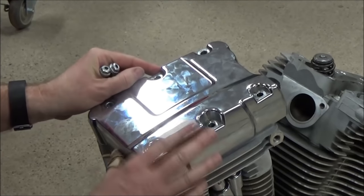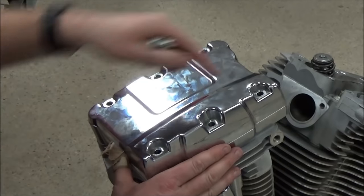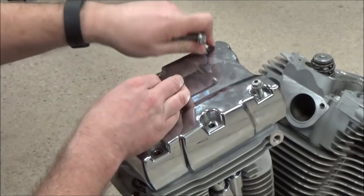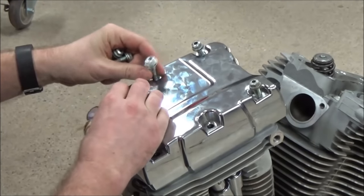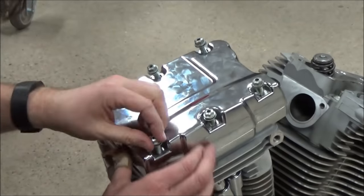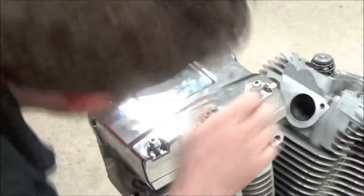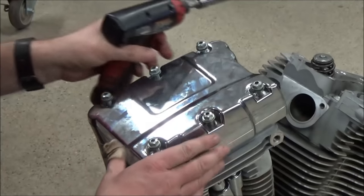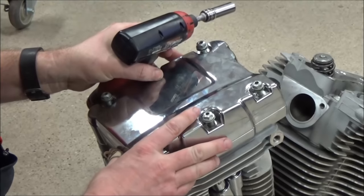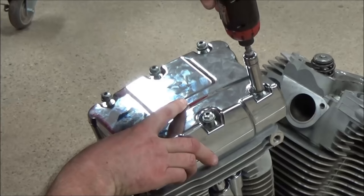What you can see here is how much this moves around. There's no dowel pins. And so I want to make a point like we do on our Evos here. You can see how long this is versus how short. Same thing as before. If you're doing that, something's wrong. You've got the wrong fastener in. And then what I like to do is just verify that we're through. You'll see here that if I take the time to square this up, I can feel this with my fingernail. If I make it nice and even and cosmetically appealing, I can just sit and kiss this here.